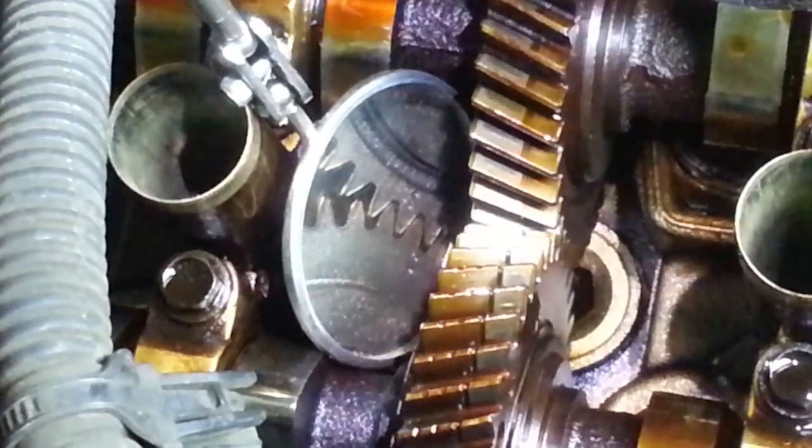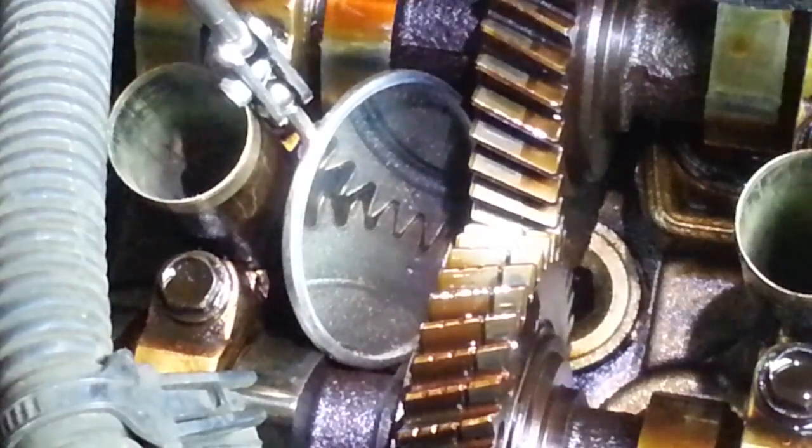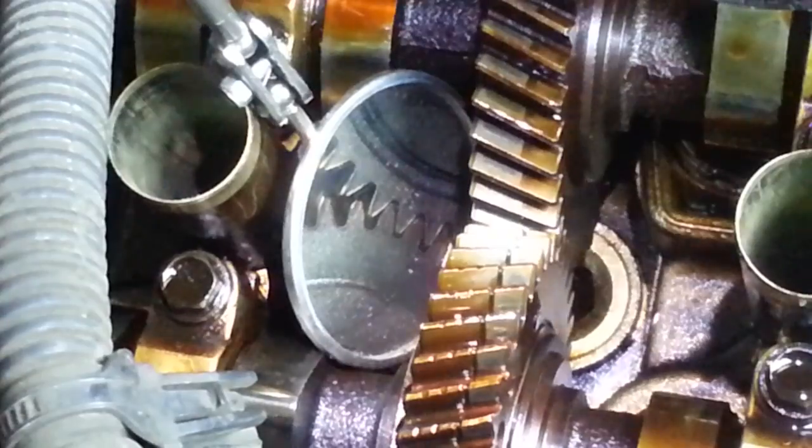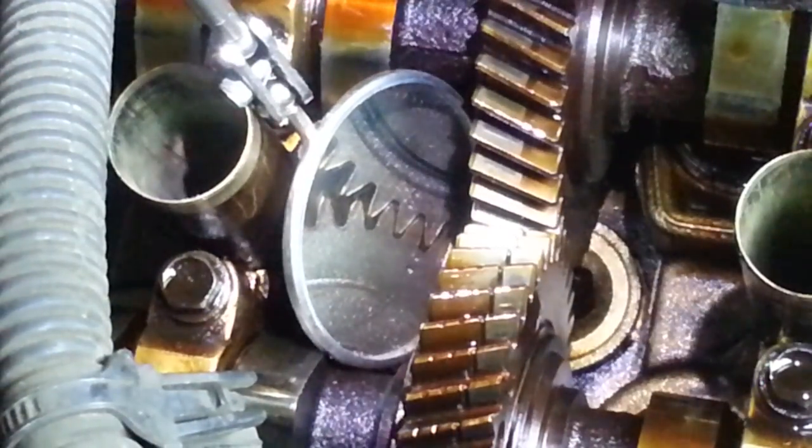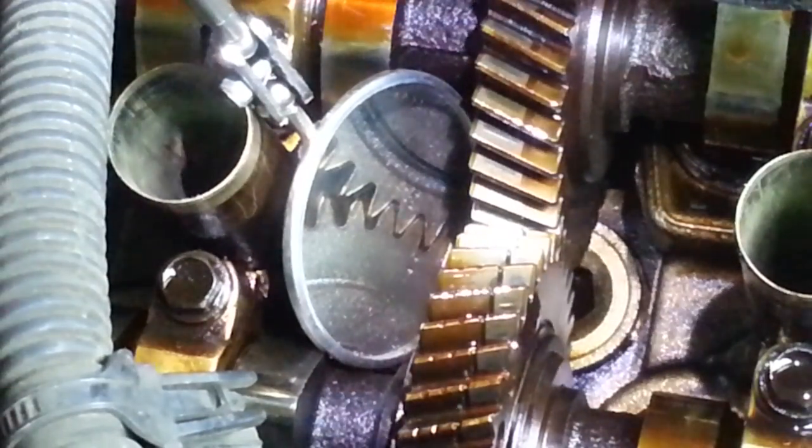And you can see that there's 2 dots on each gear. On the upper one, as pictured here, there are 2 dots on the tooth, and on the lower one, the outboard one, there's 2 dots on the valley. But what's really concerning that I've observed here on this truck is that they don't line up. They're 1 tooth off. You see that? They should be directly in line with each other.